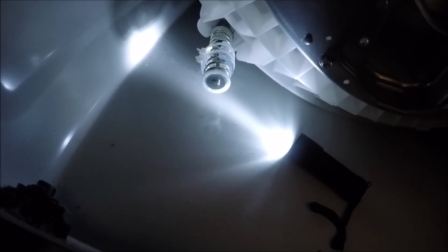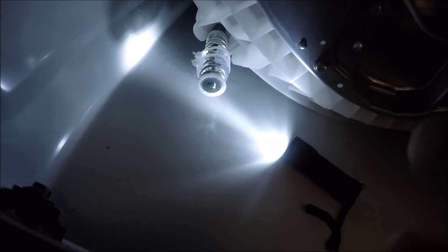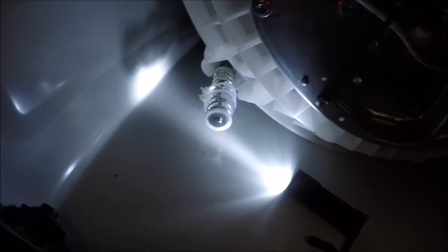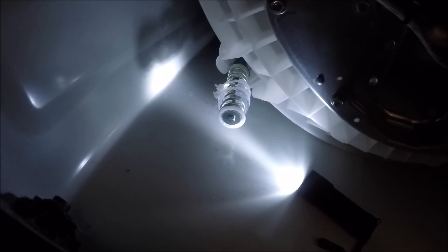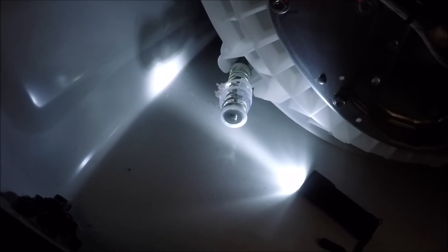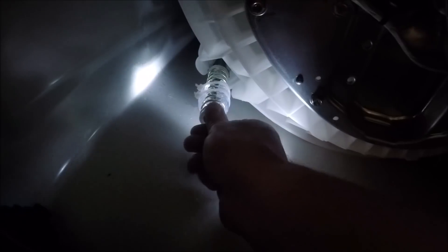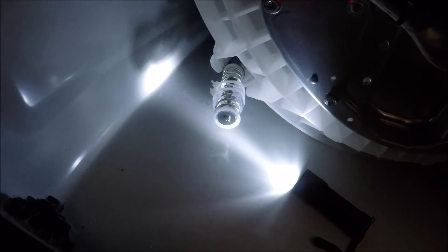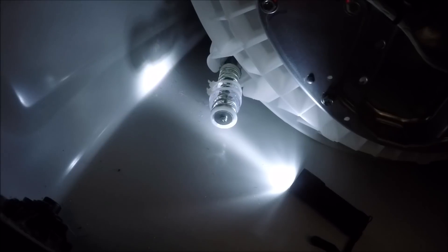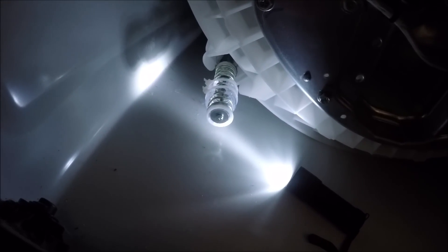Hopefully you can see the fixed part. I should have gotten inch-and-a-quarter inside diameter — I didn't see any at Home Depot, so you may have to go to an auto parts store to get a braided rubber hose with the right inside diameter. You can see that one's a little bit short, but you want a little bit short so you can tighten it up with the zip ties. You want to be able to cut a slit and either overlap or pull them together. The idea is that you strengthen the spring and make it harder to compress — that should work just fine. I saw some people online suggesting hose clamps; I probably wouldn't do that, as you might get too tight and damage the spring. A few zip ties will work just fine.